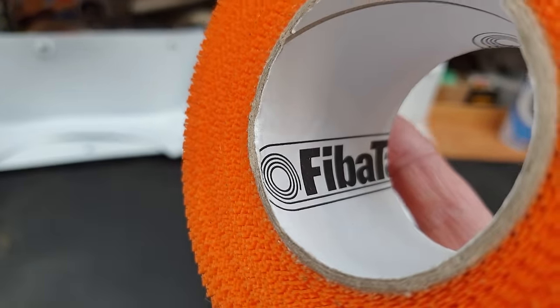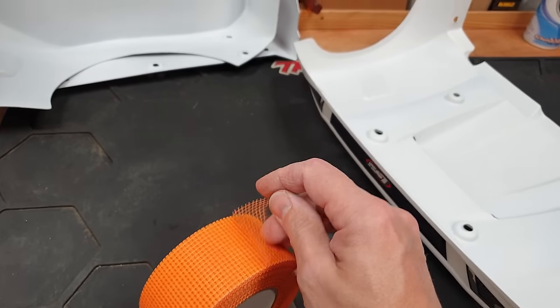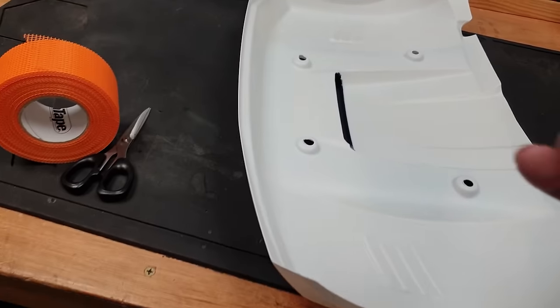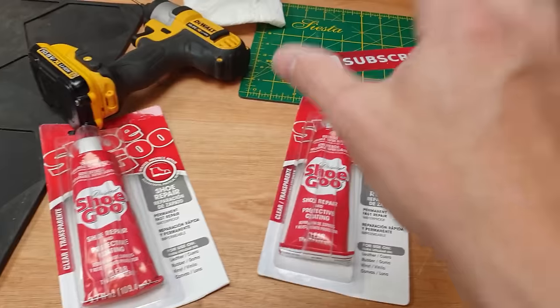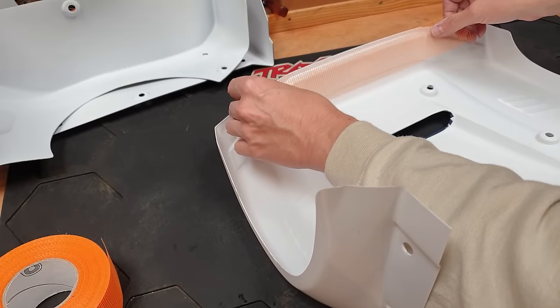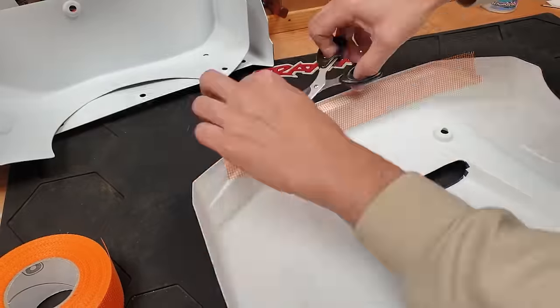We're going to give it a quick degrease — it should be fine because it's brand new and freshly painted, but just go over it to make sure everything sticks perfectly. I've done the same drywall tape and Shoe Goo mod on a lot of my bodies now and it makes them last 10 times longer. The mini Maxx for example — I've done it to that and it's gone through hell and the body is still in almost perfect condition. Without it, it might have lasted a couple of outings. Same with the X-Maxx — every time I get a brand new X-Maxx body it maybe lasts one skate park visit; with the modifications it's still perfect.